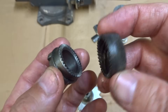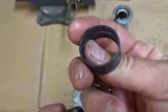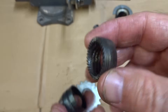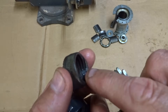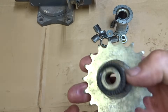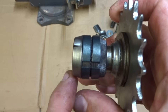I want to give you a closer view of the clutch and the expander unit. Notice there are little teeth in there and they mesh just like that. And here's the little retarder spring — it's just a little spring steel collar. This slides onto the expander like this, and then the little clutch here slides in and out of that spring. The clutch is threaded on the inside to match the driver unit, so it threads on like that. As the driver turns one way or the other, it's pushing or pulling that clutch in and out of that little retarder spring.